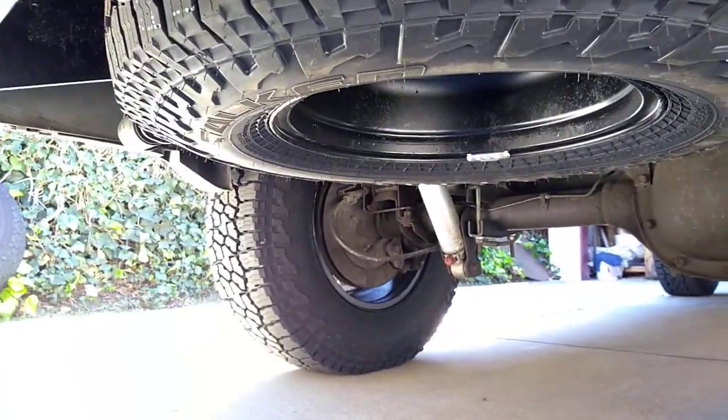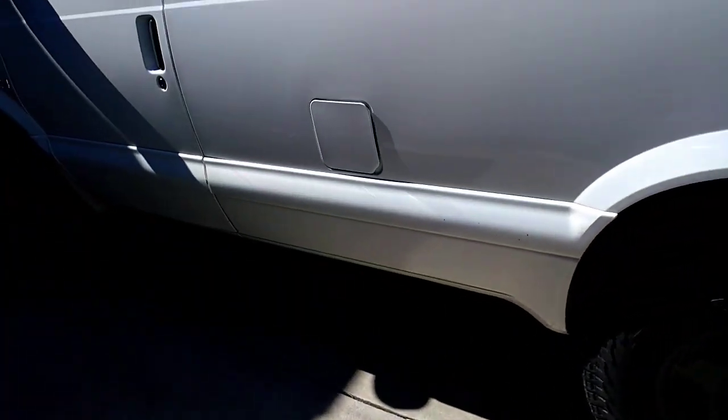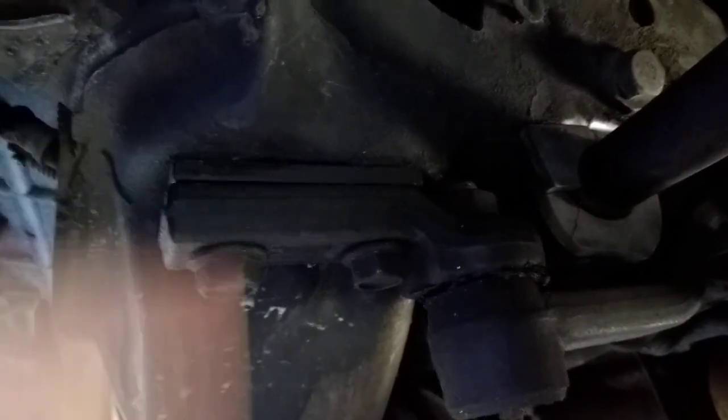Still have to do the springs. Yesterday we put this up on the lift because we were going to do an alignment. When they put it up on the lift, they called me over and pointed out that my idler arms are shot. I've redone this whole underside — new upper and lower ball joints, control arm bushings, higher-end ball joints. I had a place put my engine mounts in that I made myself, and when I got it back it had kooky steel shims in here, which I wasn't stoked with, so I made these riser blocks.